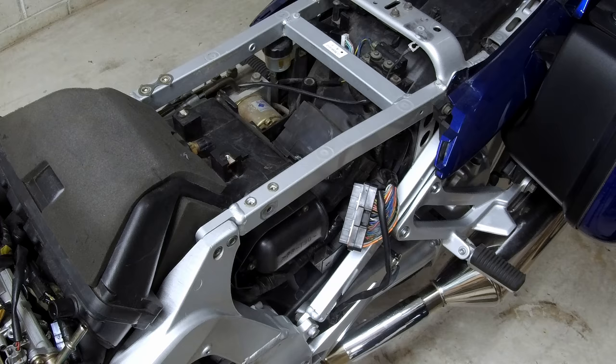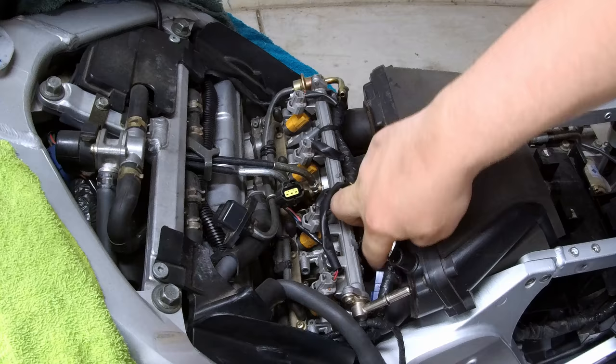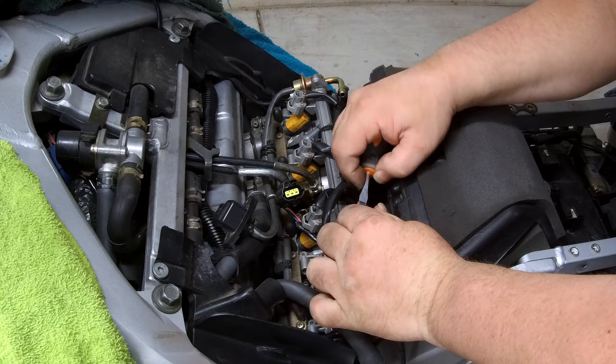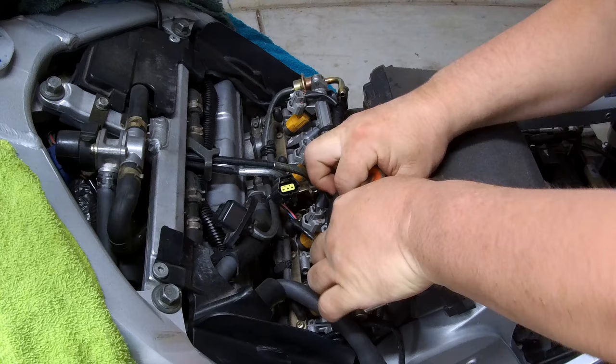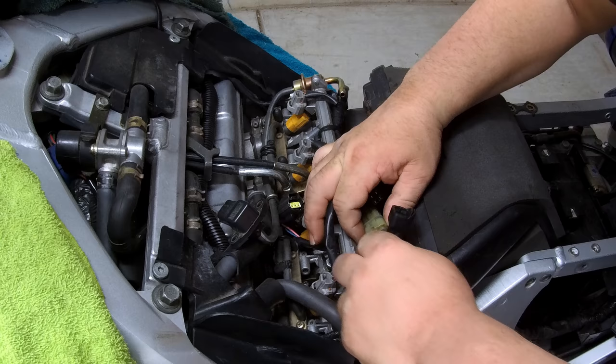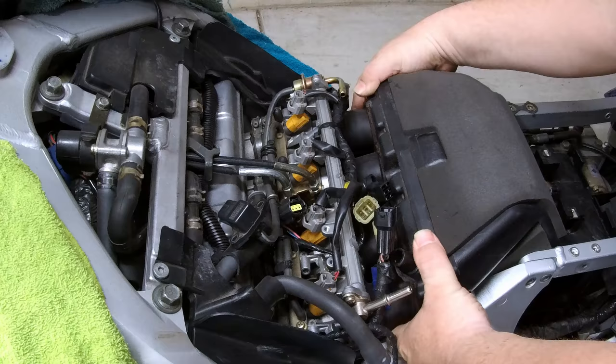Okay, we're now going to remove these two connectors here. Use a small screwdriver, go underneath the tab here and lift up and pull them apart. And on the other one, same procedure. Little tab, lift up and pull apart. Okay, let's now try to pull back on the air box and lift,